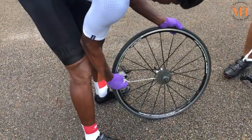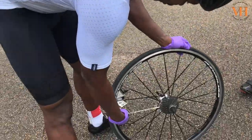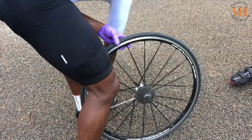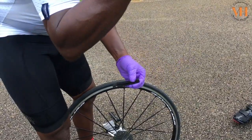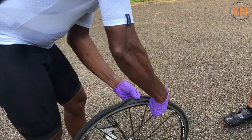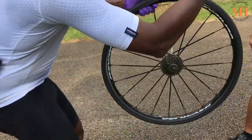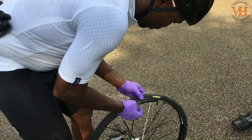First thing is, you don't need this — this is garbage. You don't need that little thing they screw down there; that's all from shipping standards, that's why they do it. With a Presta valve, no dirt's going to go in there, so you're good. Now, this is a foldable tire — I can tell, it's not a wire bead. So you need one tire lever. You can keep the other two at home. You take one lever, lift the tire — look, because it's foldable, look how easy that is. That's why you only need one in your bag — save yourself the space.